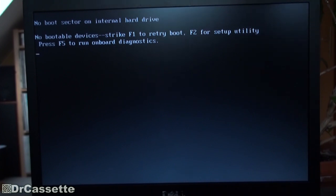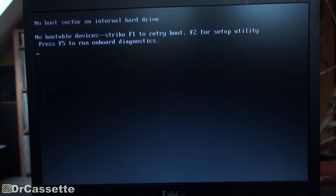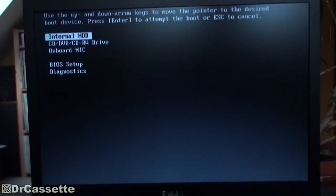Now it's time to install the operating system. This laptop originally came with Windows Vista Business, and I don't like Windows Vista. So I'm going to put Windows 7 Professional onto this laptop. I got a version of Windows 7 Professional through the Microsoft DreamSpark program — if your university is a member, students can download all kinds of Microsoft software completely for free, including Windows 7 Professional. I already burned an image to a DVD, so I'm going to restart and press F12 to get the boot menu and select the DVD drive.